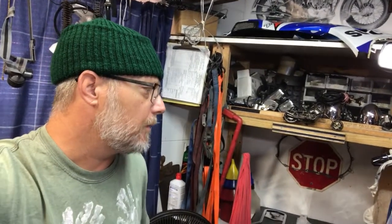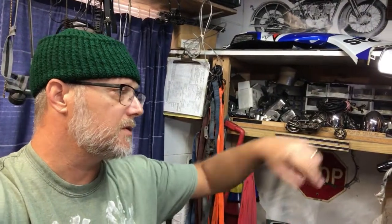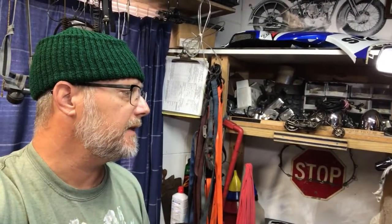But anyway, I think what it is, we just got some bad wires, or the connectors itself, the plastic plug inside, the pins aren't connecting properly, and you wiggle them and then they're connecting and it starts. So basically what I'm looking at having to do to this particular bike right now is the wire bundle runs up in behind the instrument gauge on the front fairing. We're going to end up having to pull the front fairing on the bike to get to that wiring harness. I'm going to have to get all that electrical tape off of there and go through each individual wire and see where the problem is.